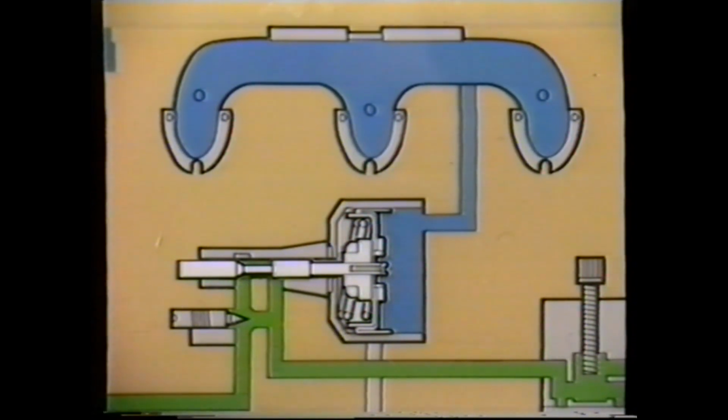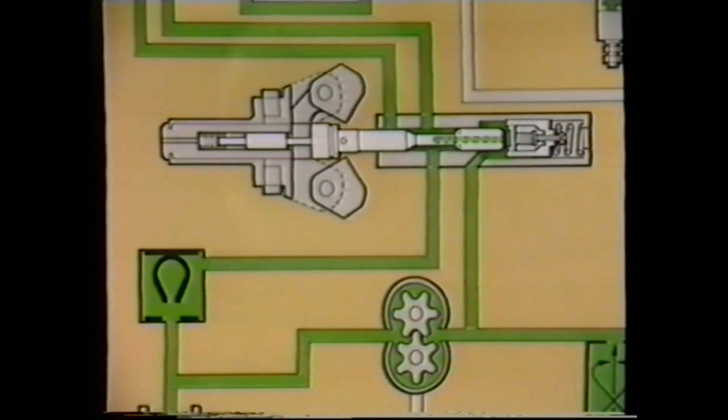Without the AFC giving this initial fuel control on engine pickup, the engine would produce black smoke until the turbo boost pressure came up. The maximum fuel pressure is controlled by this spring. And again, as with the idling pressure, the piston will move away from the governor plunger and control the maximum pressure by diverting surplus fuel back to the suction side of the pump.